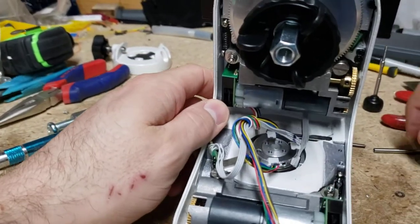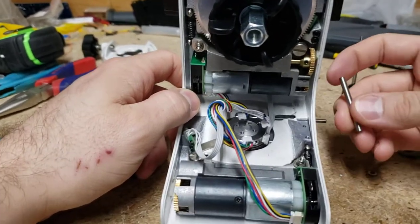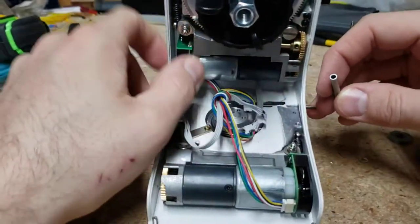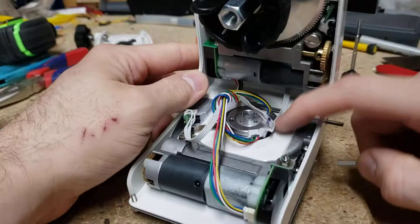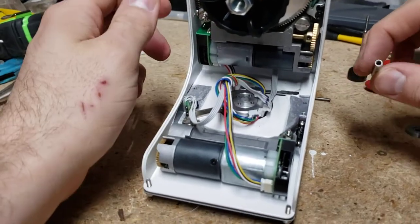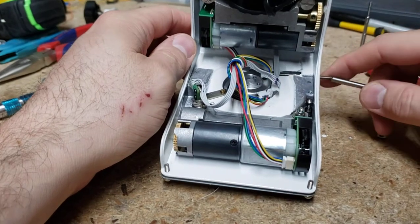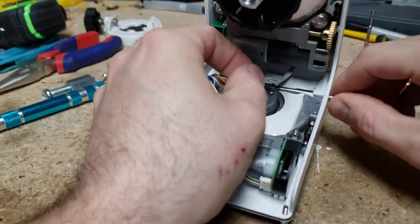And then I got this — I think it's called a clack — capillary tube. Just a stainless steel tube. It's got a three millimeter inner diameter, four millimeter outer. They make five millimeter outer diameter, which would probably be better, but I don't think this channel in here that's drilled into this can support it. You'd probably have to drill it out more, but you'd have to take out the RA gear so it doesn't get mangled, because it's right underneath this screw. So this should do for now — it's not expensive. Just three millimeter inner diameter, four millimeter outer diameter. You put it in there until it's up against the collar.